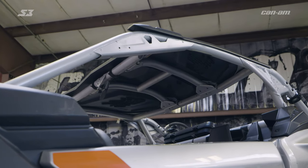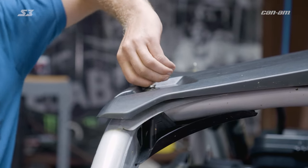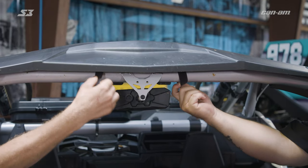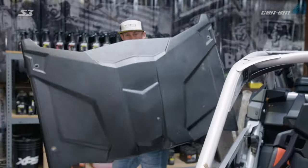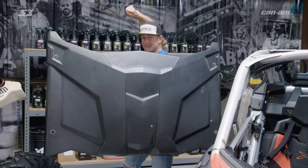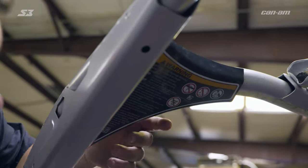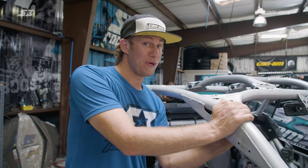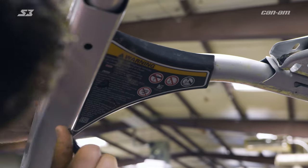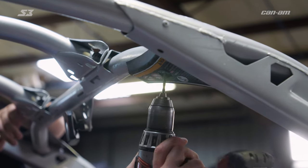The unit we're working with today has a factory roof — we're going to disconnect it. It has some quick disconnect pins on top that turn counterclockwise about a quarter turn. They're also fastened with velcro straps around the front bar that you need to undo. There are some insulated grommets underneath the roof — go ahead and get them out of the way so we're going to have to cut the warning label. Grab a three-sixteenths drill bit, your favorite drill, and punch that little rivet out.